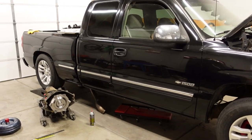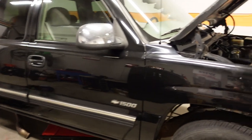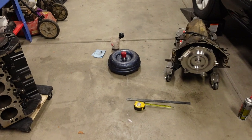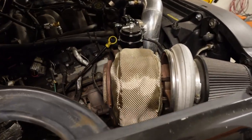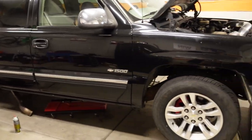Quick up to speed. Several weeks ago we removed the 4L80 from the ugly truck, which is the 2000 Silverado with the turbo big block under the hood. My objective was to replace that stock torque converter with this Circle D 3400 RPM stall speed converter to help that turbocharger get spooled up quite a bit quicker and make the driving experience a whole lot more fun.